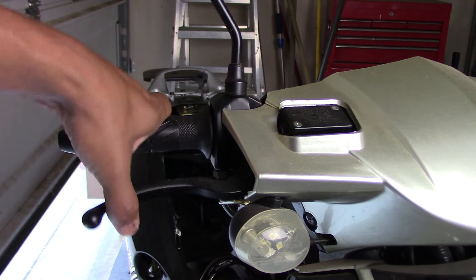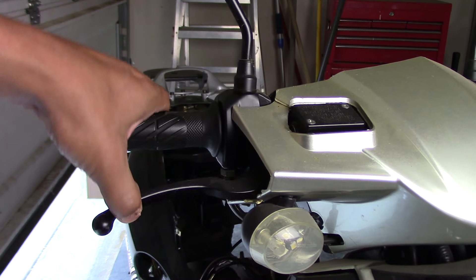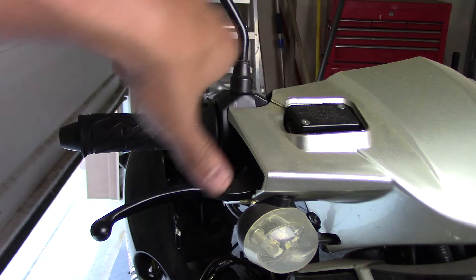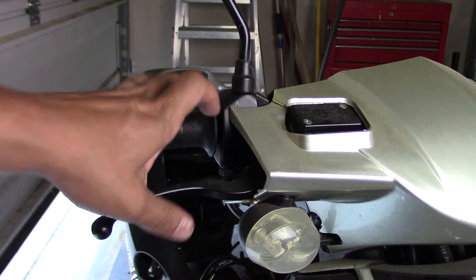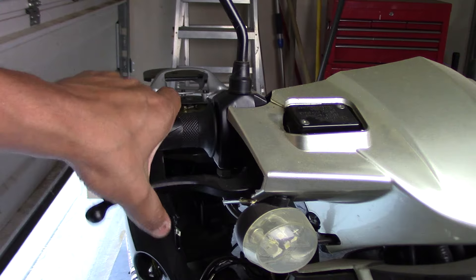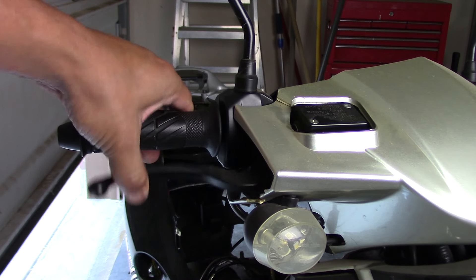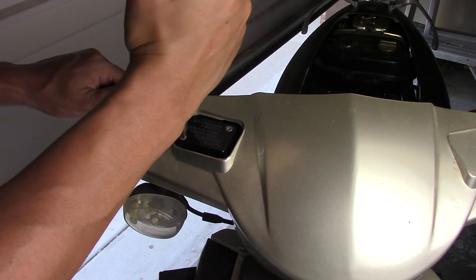So what's going on with my brakes? I'm engaging the brakes and I'm getting zero — nothing. As you can see, it's very loose. Now, most motorcycles, scooters, GY6 engines — it's going to be the same setup. You have the handle that engages and disengages the brakes, and the reservoir. This handle is actually pumping the fluid down to the brakes, so when you engage it, you pressurize the fluid, it hits the brakes, and engages them onto the caliper. But this is no bueno.